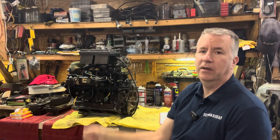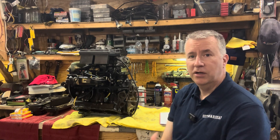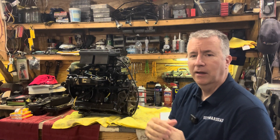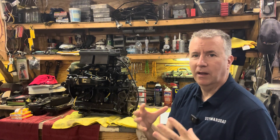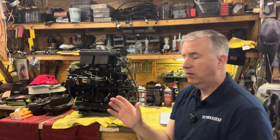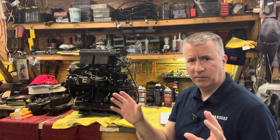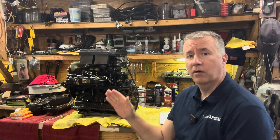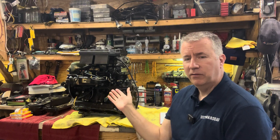The purpose here is to have a good running motor — that's what I always look for in a rebuild. Longevity. You can build these motors with really tight ring gaps and get another five horsepower out of them, and I'm not against that, but I personally like to build reliable motors. I go back to the specs in the book. Even though they might tell you when boring and honing cylinders you should be between five and a half and six thousandths — that's typical for most motors — it also depends on whether you're using forged pistons or the manufacturer's style pistons.